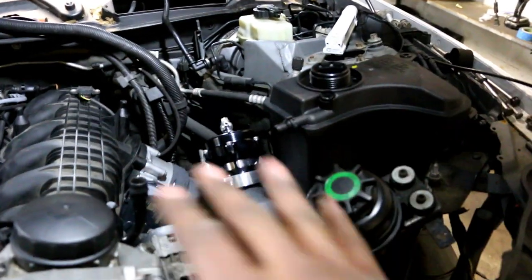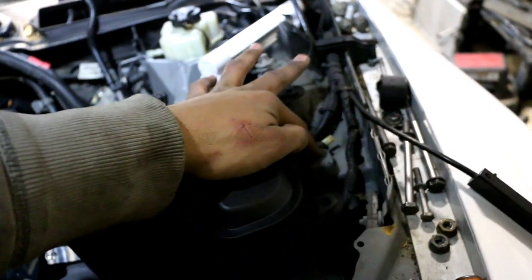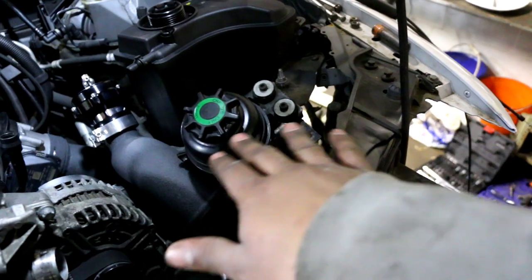The reservoir is shaped a bit different and right now my plan is this bracket over here is stopping it from sitting flush. When you look at the engine bay pictures from a 335D, you can see that this tab is actually bolted right here. I'm going to remove this bracket and see where it falls — the power steering is easy to mock up because you have a lot of flexibility in the hoses.